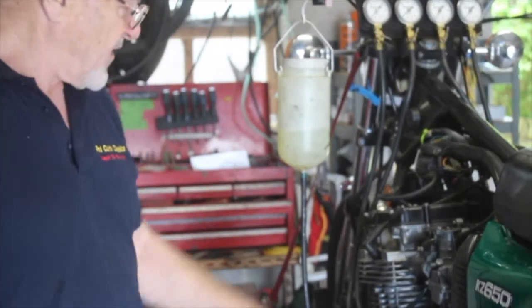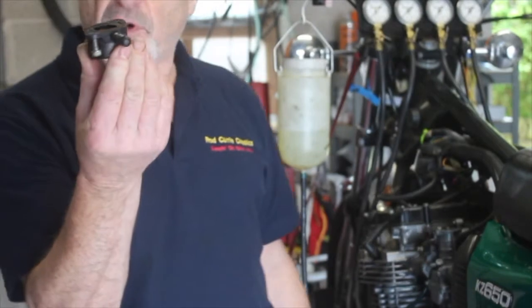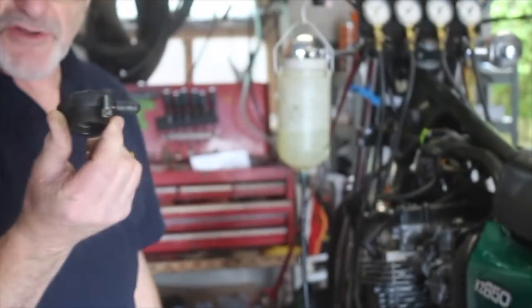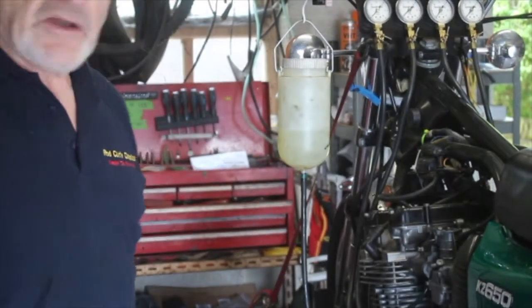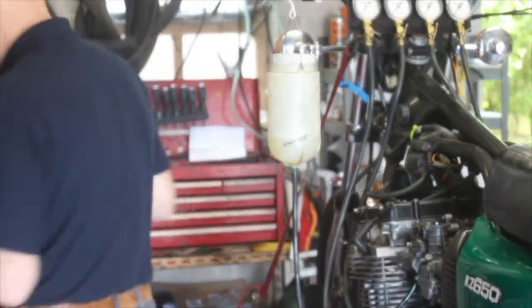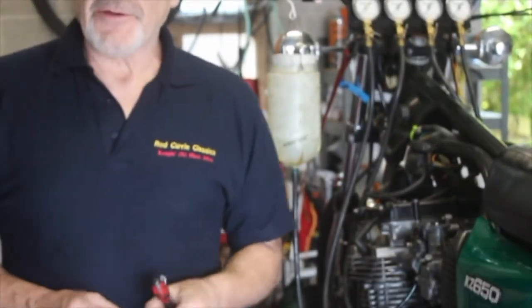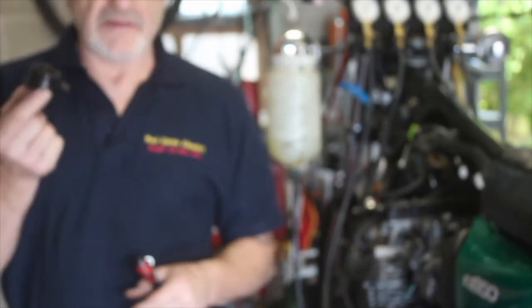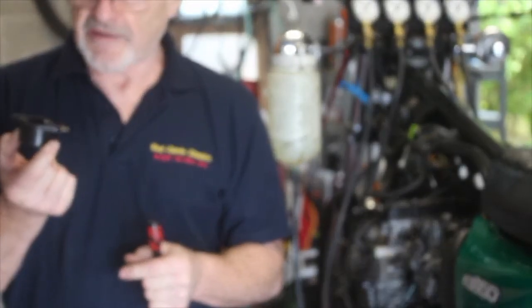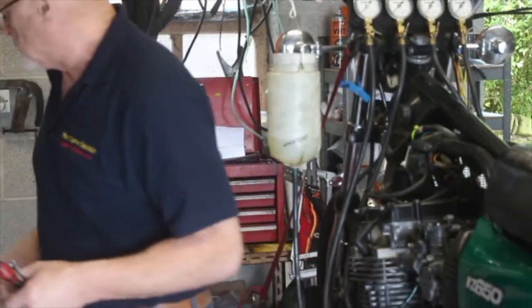So I'm going to show you how I should have checked it from the start. Let's start this bike. You can see the vacuum there is down, and that's because the joint between the little rubber and the cylinder head is poor. It's this joint here between this rubber and the cylinder head that's at fault. It was nice and soft — that's what fooled me previously. I thought it just wasn't biting down properly into the carburetor, and the fit of the clip wasn't quite the same as the others. Someone's been in here before — one of the bolts is slightly different. So I'm going to pop the carbs off and see what's wrong with this joint — see if I can fix it, or swap it from another bike I've got.